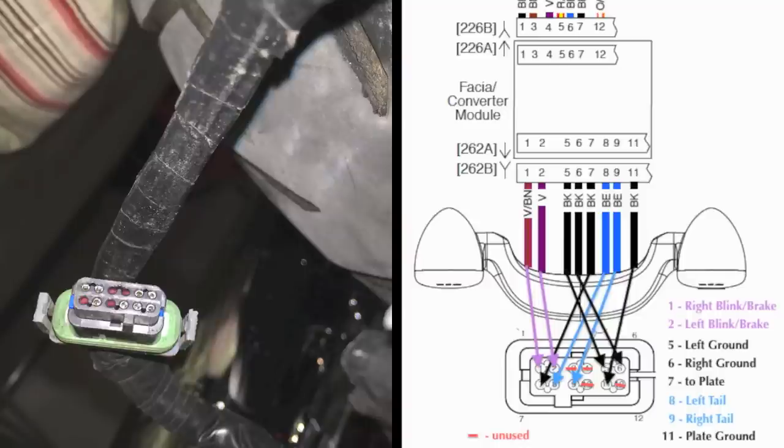The way to view this is the connector on the left would actually rotate around and go into the socket shown on the right, or you could view it as the backside of the connector. Either way, you'll want to make sure you're using the appropriate diagram for your particular application and annotate appropriately — which wires, specifically, because those are what you're going to tap into: the ground for the lights, which ones are essentially your tail light leads or the dim connectors, and which ones are your bright leads or your blink and stop connectors.